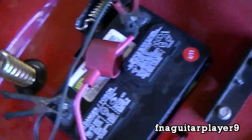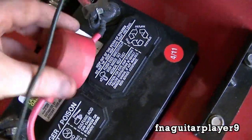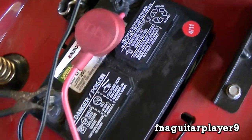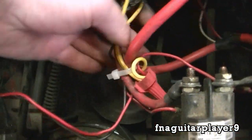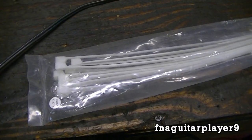This is the way most newer mowers are set up, with the battery under the seat. If that's your case, after you get done charging it, be sure to put the rubber boot over the positive terminal so when the seat comes down, you don't have to worry about anything shorting out. I put this strap all the way around and catch the wires — that way you don't have to worry about any wires getting caught up in the pulleys. Here's the solenoid on this mower. I'm using these big 24-inch zip ties — they work pretty well. It's basically what the factory puts on them anyway.